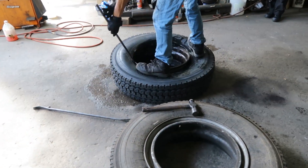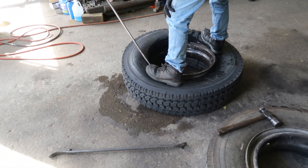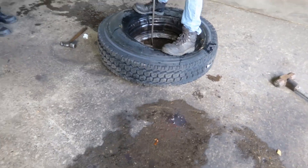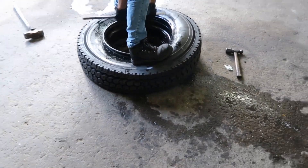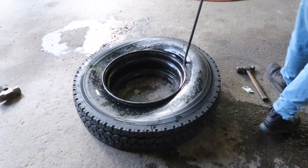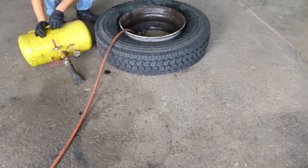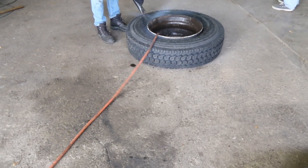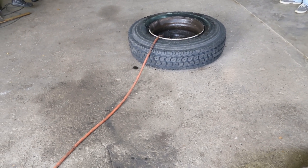This is a little bit more time-consuming and a little bit harder just based off of using this one breaker bar, but it is getting the job done and working perfectly fine. The second tire for the one side in the back of the bus gave us some difficulties, so to get that last bead over the rim, we just used a sledgehammer. To get the air in and set the bead, we used a device that kind of just throws air into the tire and sets the bead for us.